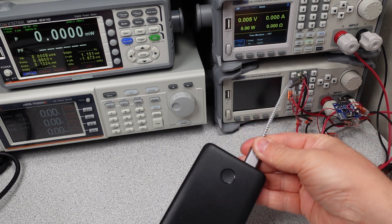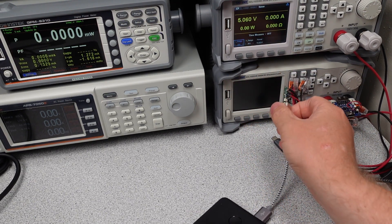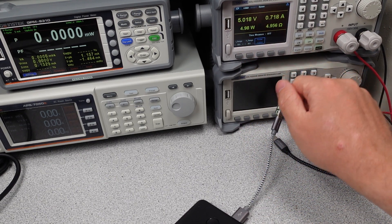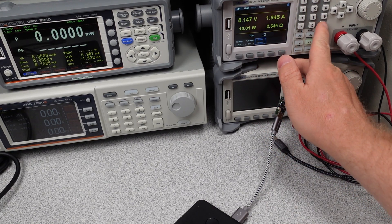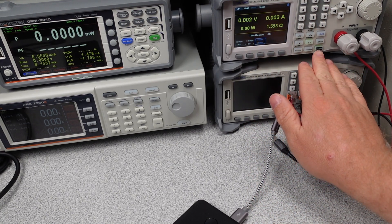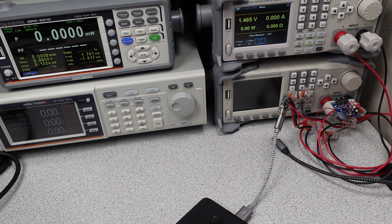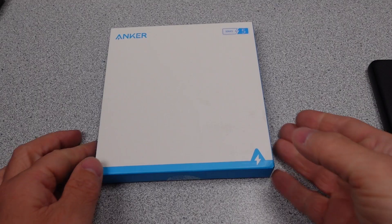Here we're talking about a slower overnight charge into your phone. This is fine if you want to carry it around all the time — it'll easily double your phone's battery. It's just not much smaller than the 20K mAh counterparts I'm looking at next. This powerbank uses a lot of energy to charge but doesn't have much energy on the delivery side compared with its rating, meaning it's a really poor performer. The powerbank wastes almost half of the energy you put in. It doesn't get hot because it does so slowly, but almost half is just sad. It really seems like they didn't try on this one — it has to be a linear regulator on charging or something. It is so inefficient.